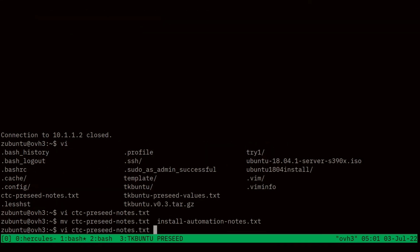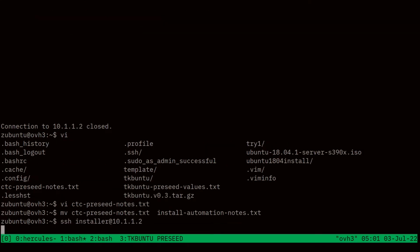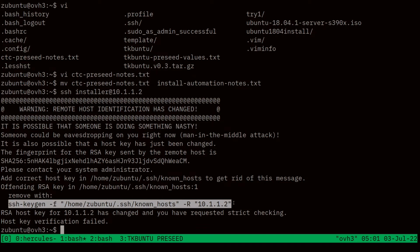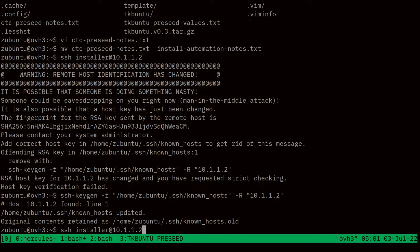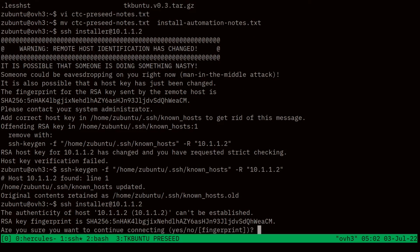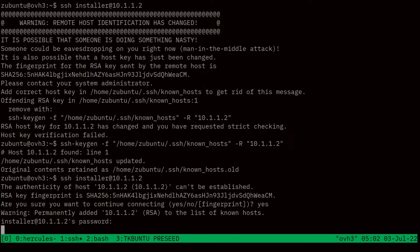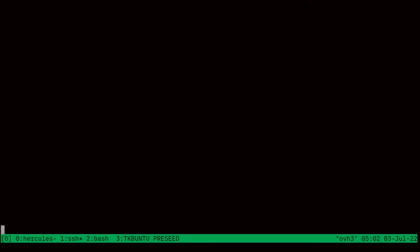Well, we can ping. First of all, see if we can ping into it. Well, we can try to SSH into it. Yeah. So the network between it and Linux is working. Doesn't mean necessarily the reverse, but we don't know if it's able to get out to the internet. It would point more towards the DNS issue. It's possible the DNS server isn't being set. It's possible the default gateway isn't being set correctly. Yeah, we can't get into the installer at all.